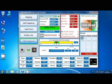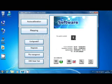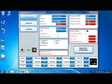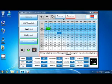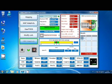To end this page we need to see the last feature, the engine load reading. To see it we need a Valvetronic vehicle. This is obviously not a Valvetronic vehicle, but just to see how it works, we will tell the ECU that this is Valvetronic. Here in configuration, set Valvetronic flag. Now that we have enabled it, here with the adaptivity, you will see engine load reading.